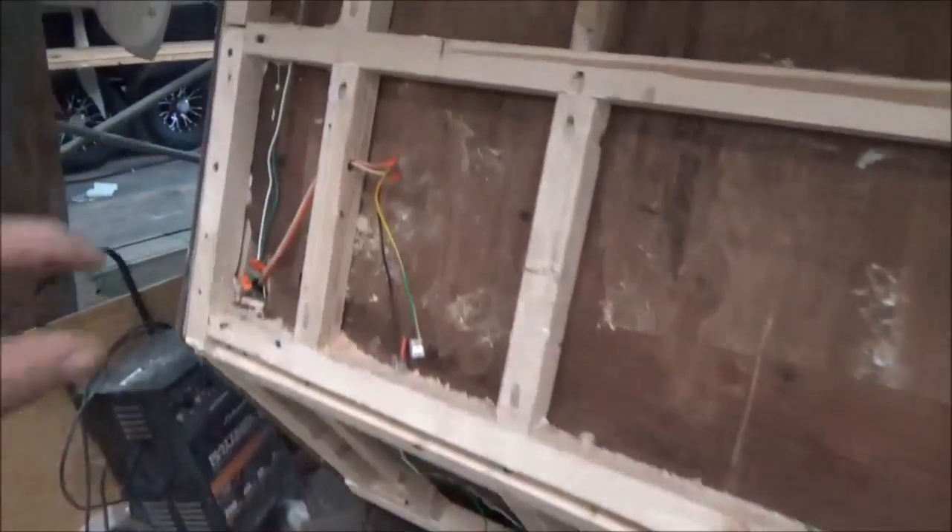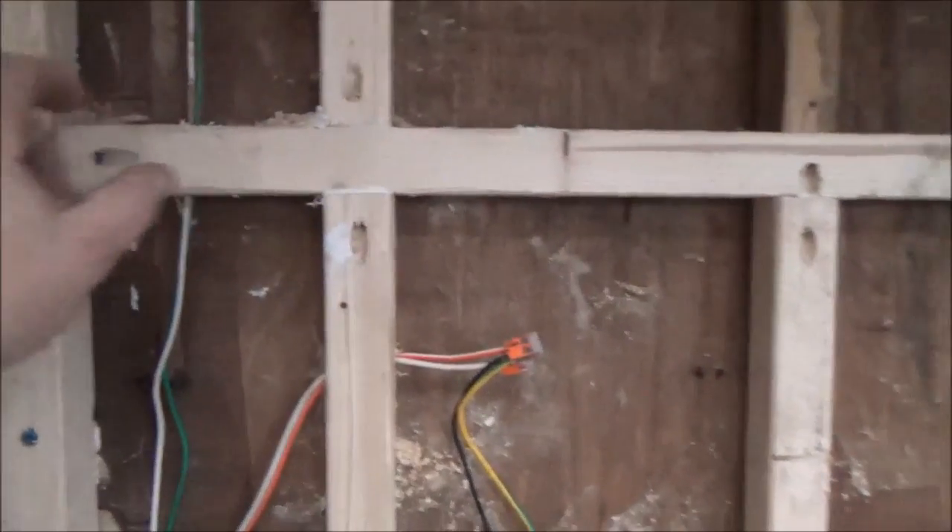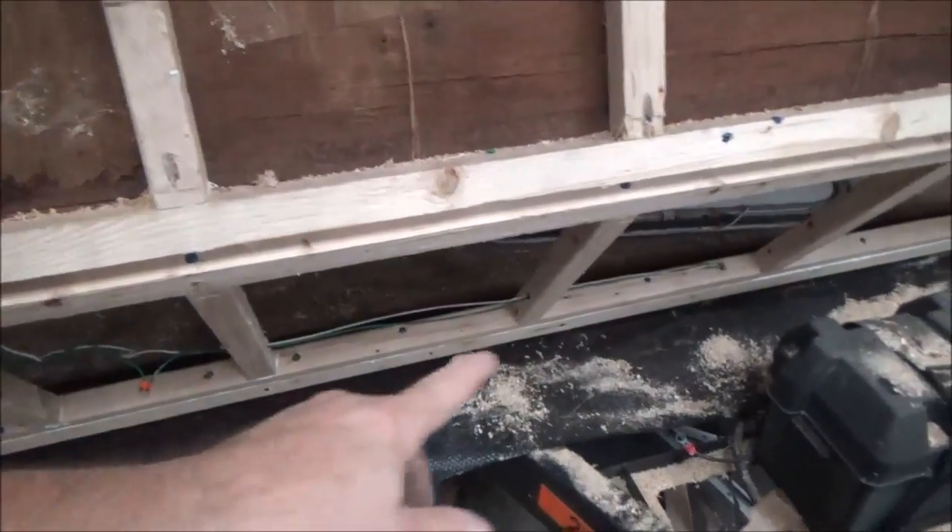On the Freedom Spirit we've got all this framed — everything's all together. The big piece goes down at the bottom. We've got it all insulated, glued and fastened. Now we're just getting this piece prepped and we'll get the insulation in there. We already ran the wires, and we're going to put some plates on here so we don't ever get any staples through them and compromise the wires.